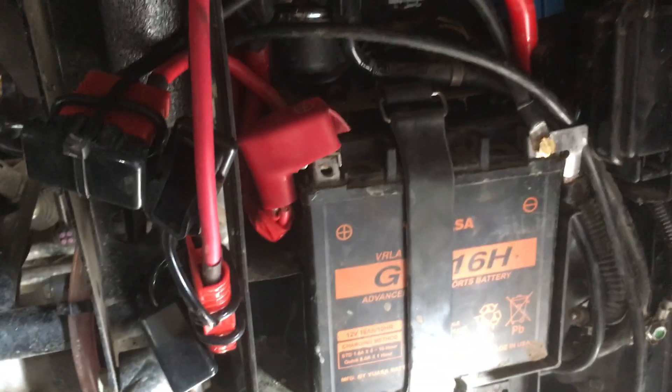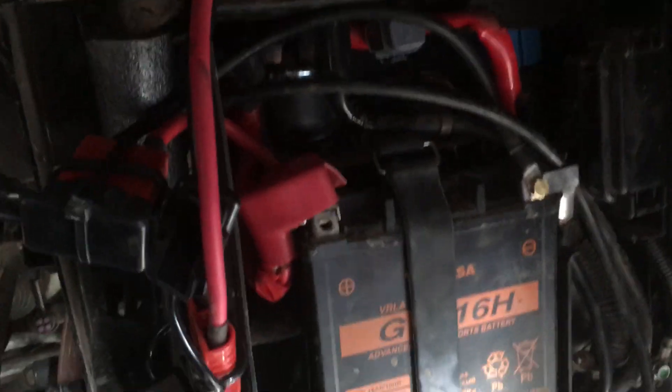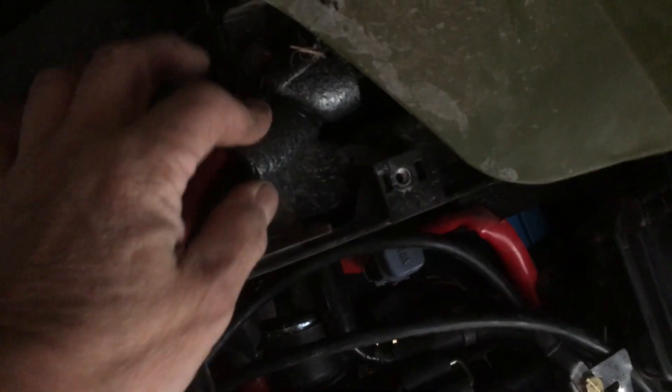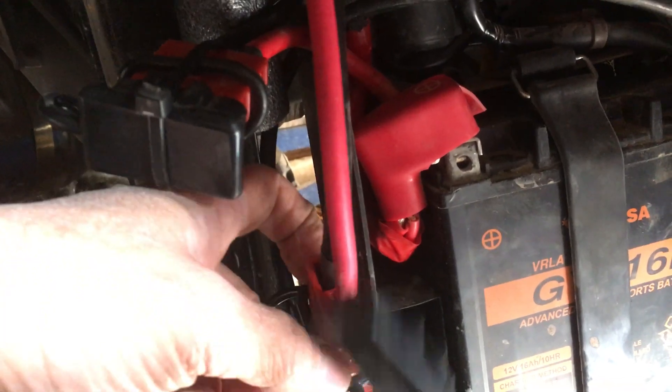Based on my maritime Coast Guard experience, I did not like the way Honda did anything. What I did is I used commercial quick-disconnect battery connectors. Right now that battery comes down — I have chafe guard up here. That battery connects directly into the winch circuit. That is the power going up forward to the winch — not the controller, just the winch.